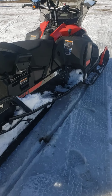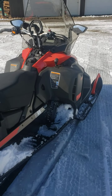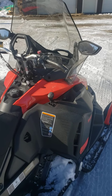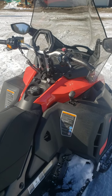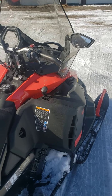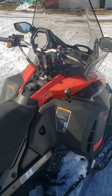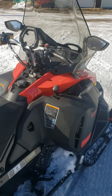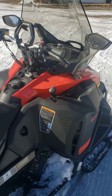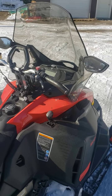I'm not really too afraid of getting stuck with this thing, and we'll have the winch too, so that'll be nice. The only thing — and I mean the only thing — I don't like about it is the ITC throttle. Even in sport mode it's not as fast-acting as I'd like. I wish they would just get rid of it and put a cable throttle directly to the throttle body so you directly operate the throttle valve mechanically, rather than with this ITC. I think it's the crappiest thing and it's the one thing that makes me not want a 900 ACE.